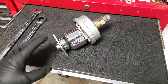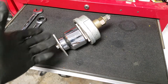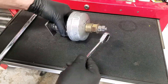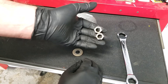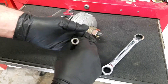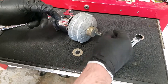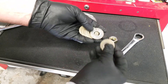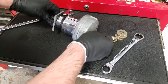This bushing press is homemade, and this makes the job — you have to have this to do the job. Let me take this apart and show you the components and where I got them. Grade 8 nuts, half inch by 19mm, 3/4. I just use this as a big spacer — it's just a huge nut. A whole bunch of washers, which I'll use as spacers — get the high-grade. And then this is probably the hardest thing to find.